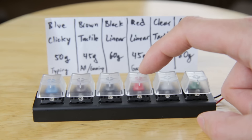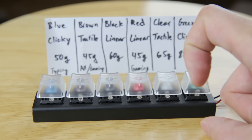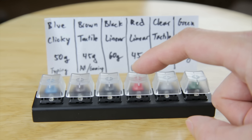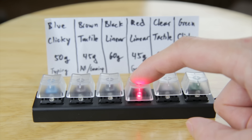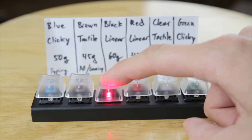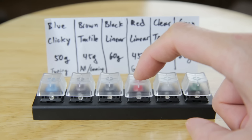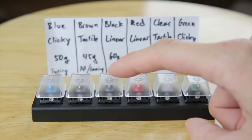The middle two are the linear switches, which means as you increase the force, you're going to press it more and more. The red one is the one I have on my keyboard — it has a 45 gram activation force, and most people like it for gaming, but I like to use mine for typing as well. You see as I press it, it lights up in the middle and I can still press it some more before it bottoms out. On the black one, I can press it and halfway it turns on, and then it bottoms out. It does feel like I have to put a little bit more pressure on it, which is something I don't like because I don't want to fatigue my fingers too much when I'm typing. I want it as light as possible while still functioning, so that's why I like the red one more than the black.